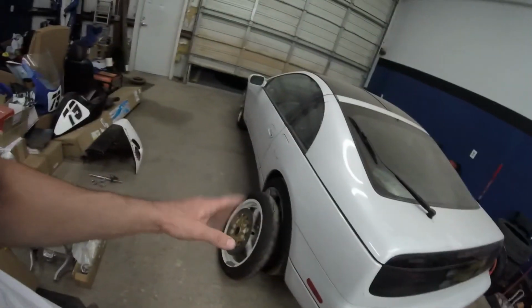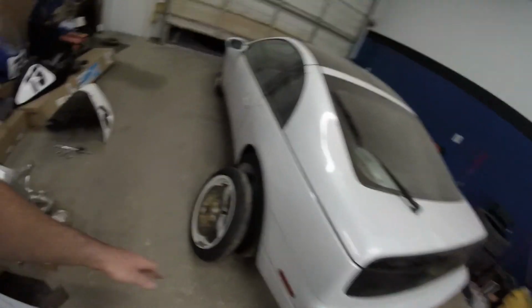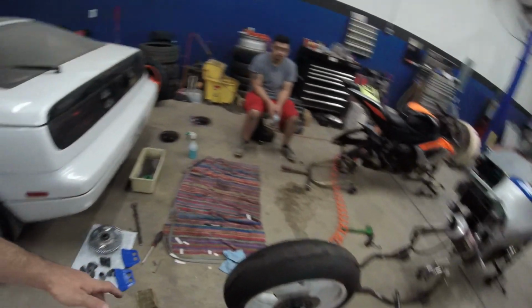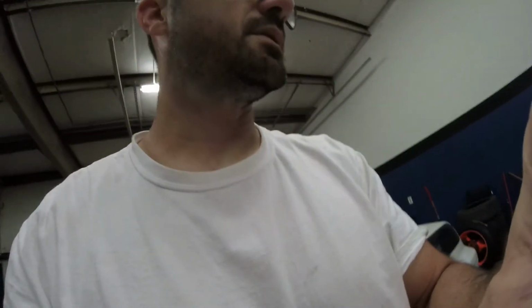These are worn tires. They didn't have the dot where you're supposed to line up where the valve stem's at. A lot of people say that doesn't matter. I like to go by the rules. So I just stuck those on without lining up the dot because the dot don't exist anymore. And they both balance the same. So I'll call that good. I'm gonna go ahead and move on to my other rims. And then after that, I'm gonna mount them on the bikes.